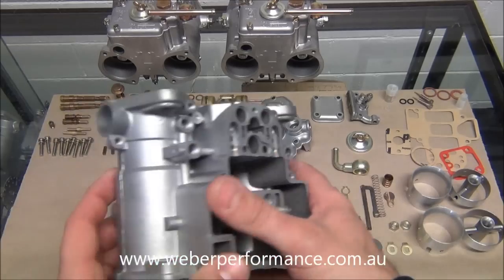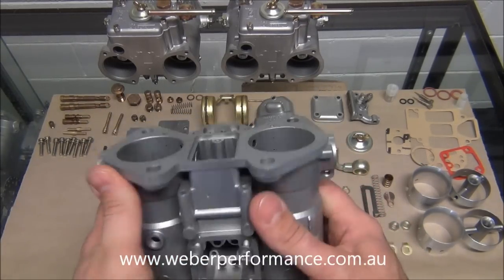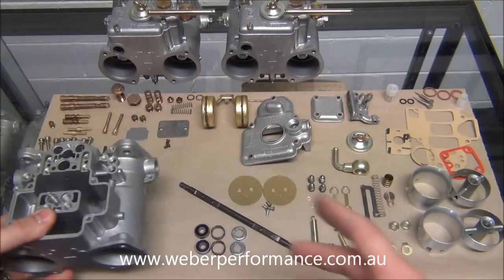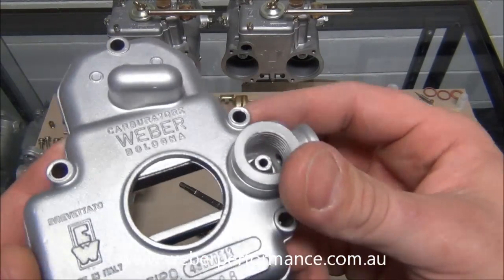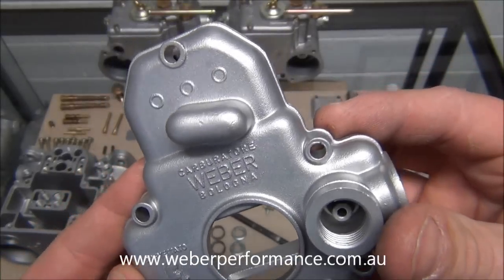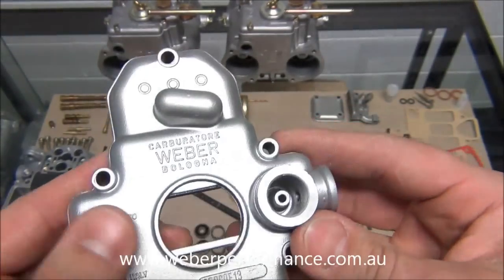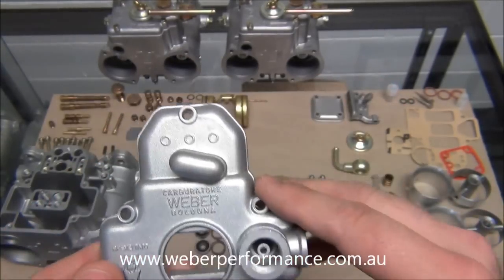You'll see here the bare body being hydroblasted gives a nice finish — very nice and smooth, brings the alloy right up to its former glory. On the top cover you can see a really nice smooth finish which is fantastic for keeping clean. You get grease or oil on those and it'll just wipe straight off. It just smooths out any porosities in the material.